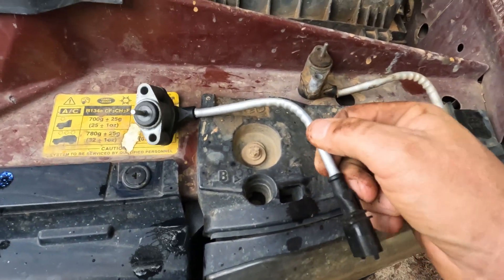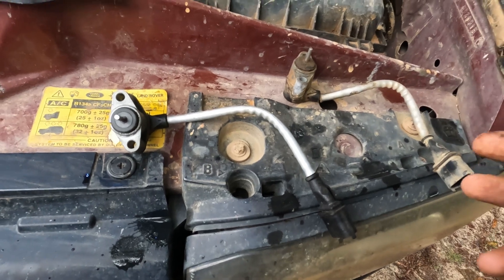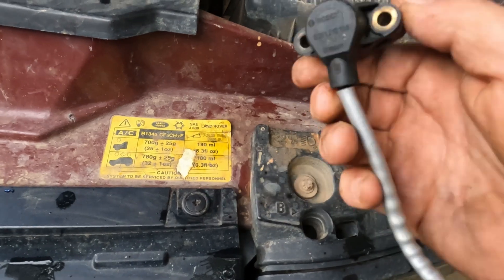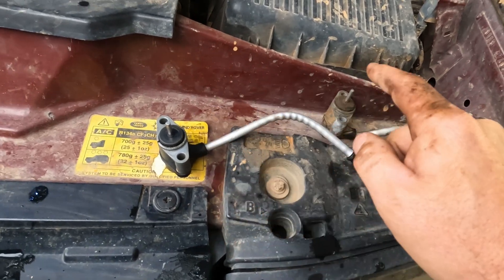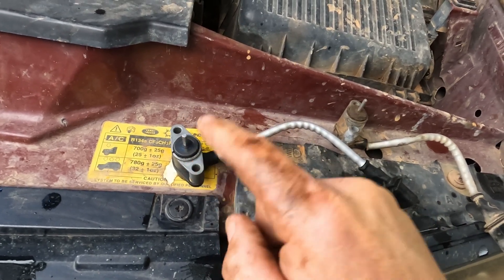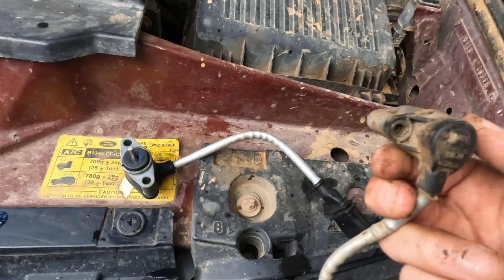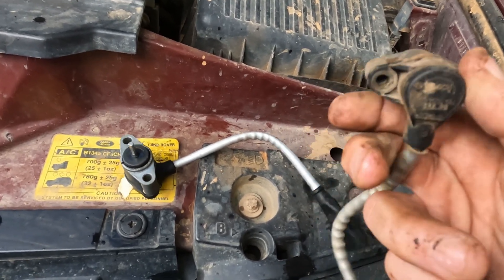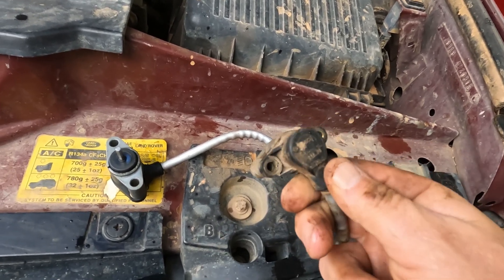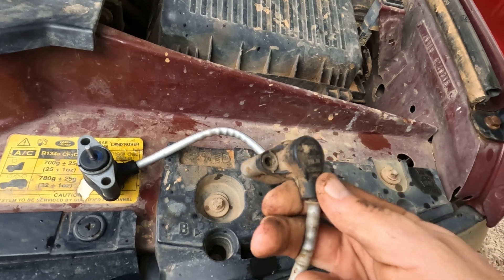Here's the crankshaft sensor out of my truck. This is a known good replacement out of one of my parts trucks — a factory original Bosch. The reason I'm installing a used one is for testing purposes. This isn't a horrible job, but if I'm replacing the sensor I want to replace it with a new OEM Bosch sensor, which is about $130, and I don't want to take a shot in the dark. Since I have a known-good sensor I'll install this one and run it. If it solves my problems I'll buy a new one. If you don't have a spare and you have a crank-no-start with codes related to the crank position sensor, it's a very known issue on these trucks — there's no fail-safe; if this sensor goes bad the truck will not run. Just go ahead and get one and swap it out.